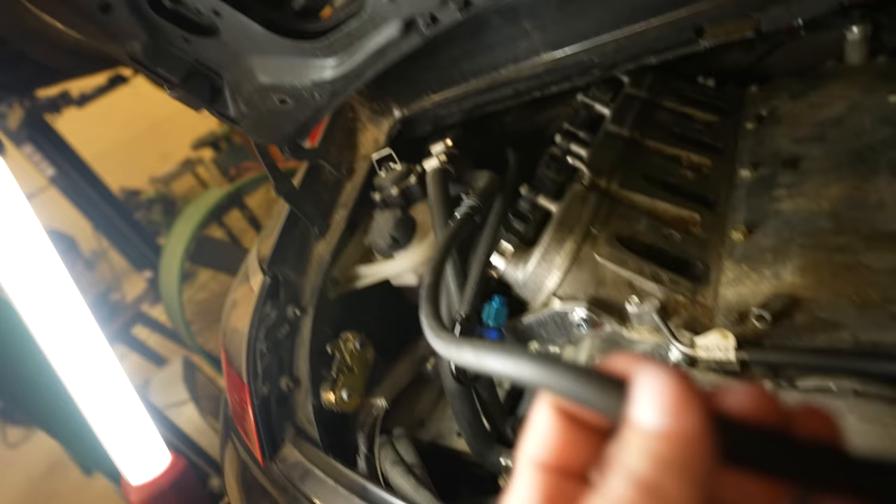I was hoping the fuel pump and AC relays and stuff were in this bulk of relays and fuses, but they're not down there. My initial thought was to just use the triggers from the Holley to trigger the factory fuel pump relay and do the fan relays while I'm at it. But the more I think about it, eventually all that stuff's going to get changed out and trying to backtrace it with the dash being a nightmare - so I'm just going to run my own relays for the fuel pump. I'll run everything as if I'm going to power up two fuel pumps, so I'll have two relays and two fuses. I'm not 100% sure if I'm going to do solid state relays for the fans - these fans have high speed and low speed, and at some point I'll probably switch over to PWM fans, so I'll just wire it accordingly. None of this stuff's set in stone - I'm still kind of winging this. I get like five minutes a day to work on it.